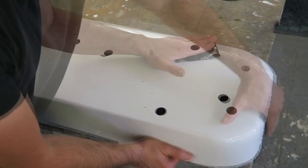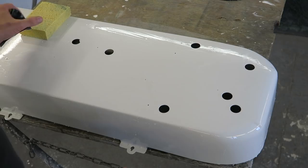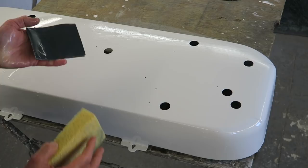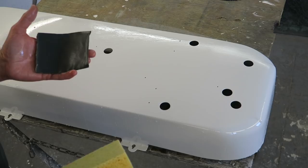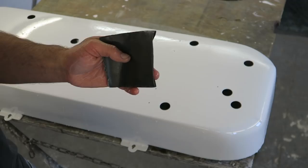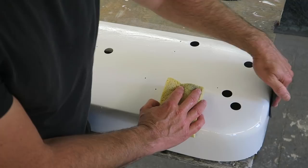Of course, I've gone completely overboard with this. This looks far too finished off for the product. In the practical videos on his YouTube channel, they've got a fantastic sort of '32 Ford or something. It's a fiberglass kit car, so it's a fiberglass shell, and they've literally buzzed it down with 240 on a DA on the gel coat, and then just put the paint straight on top of that, which I can see is going to be absolutely fine. That'll stick really, really well. And of course, fiberglass isn't going to rust in any way.